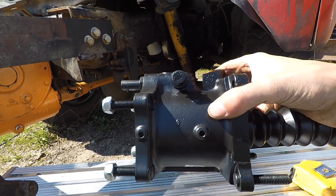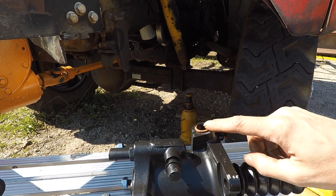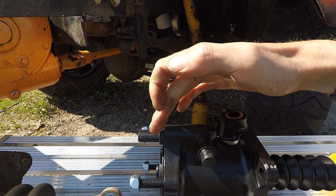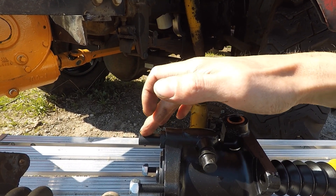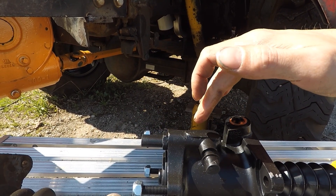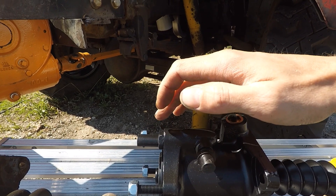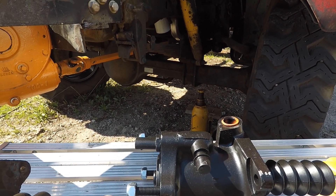This is the HydroMax unit. This is your power steering pump inlet, and here's your return. This right here is a safety switch — a warning switch. That is normally closed, and if you've got an issue with it, it opens, makes a contact, and this one gets wired up with a light on the dash.